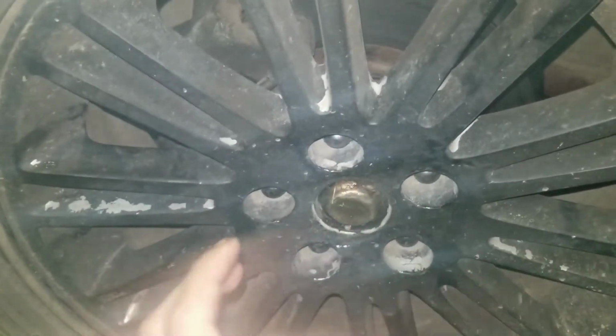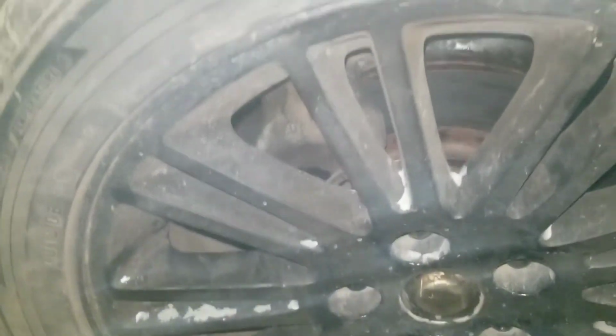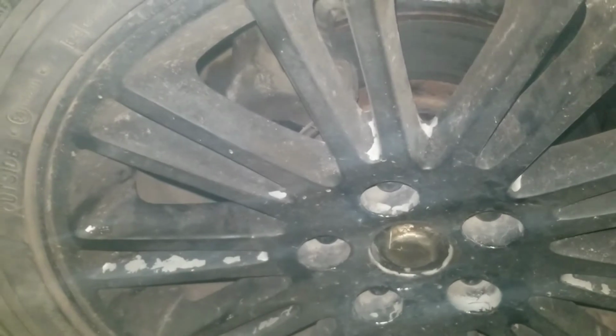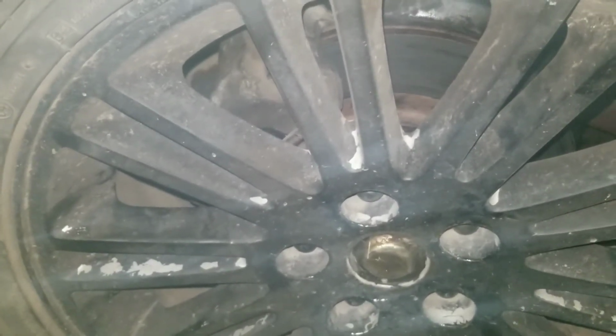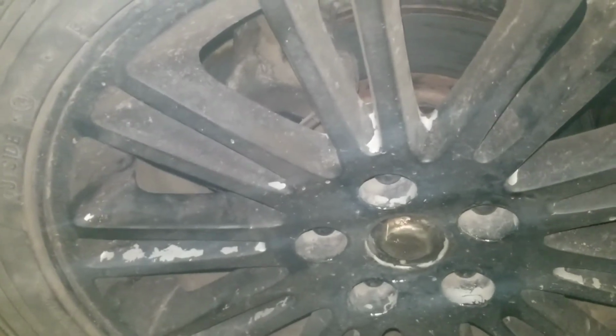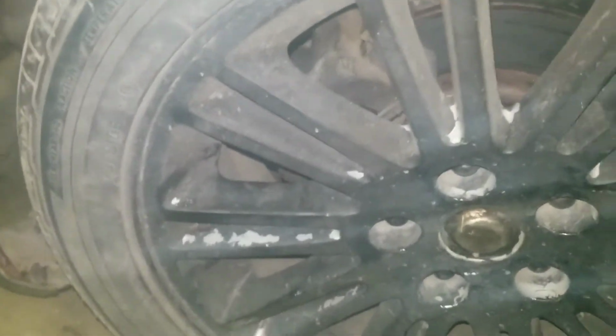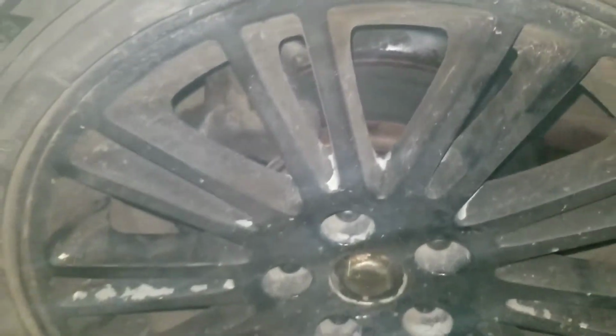the bearing has to come off in order to take the rotor off, and then you have to put it back on. So that's a deal on its own. Best way to go about this is '88 turbo hubs. That'll make it a slip rotor on, slip rotor off. That way you don't have to do that. But they didn't have it for me, so I have to do this type, or back to the stock type.